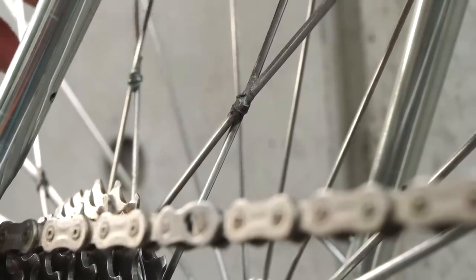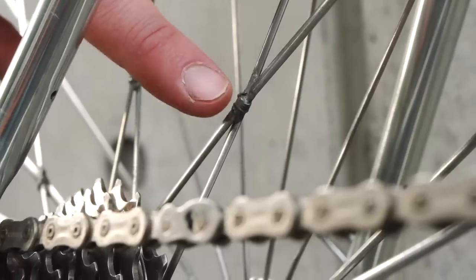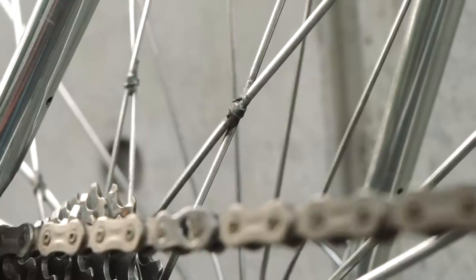Next up is tied and soldered spokes. Not commonly seen anymore. Basically, it was where you tied and soldered spokes together using some lead solder melted in place. Loads of people thought it was going to make a wheel really super stiff, but in actual fact, it just relieved the stress of the J-head of a traditional spoke where it goes into the hub shell, meaning there was less chance of it breaking there — inevitably giving it a longer life. Loads of sprinters used to use them too. Funny, isn't it, that so far the first two things were both used by track sprinters.